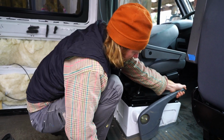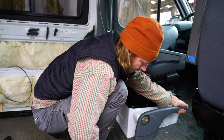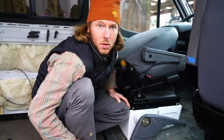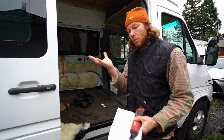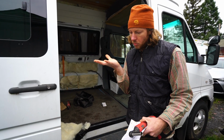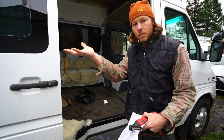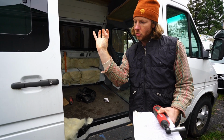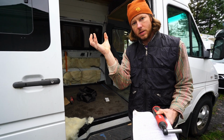So I want it to be able to be tight about there, and what that involves is taking up some tension under the van. So I guess it's time for me to go into the van now. I'll loosen 4 mounting bolts that are 13mm. The bracket will slide towards the back of the van. I'll tighten those bolts up. I'll loosen another 13mm bolt, and I'll rotate the assembly, and that'll then take up the slack.